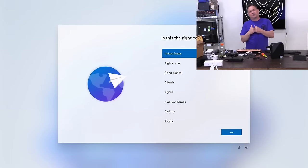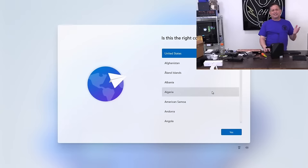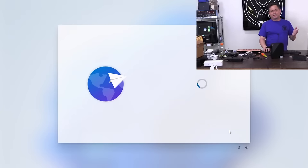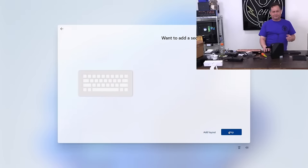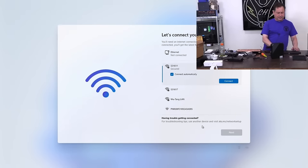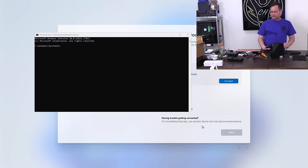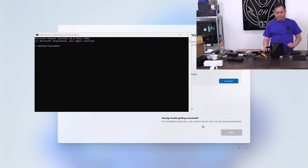It's almost easier to just reinstall the operating system under AHCI mode. And it's just, you know, I think you get a little better performance out of the RAID mode on those Dells, but I don't think it's worth it. Because that means anytime you have to work on your operating system, you need to be able to load the driver. All right, Shift F10. Just making sure my audio is going out. Yeah, okay, good. And of course, we should all know this by heart.